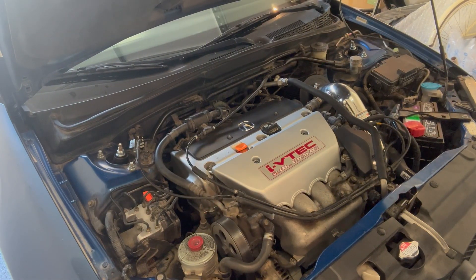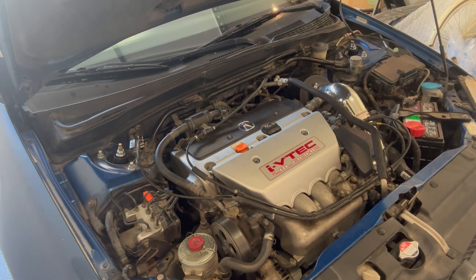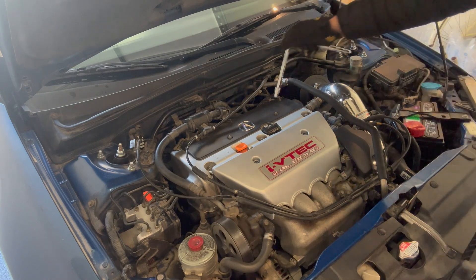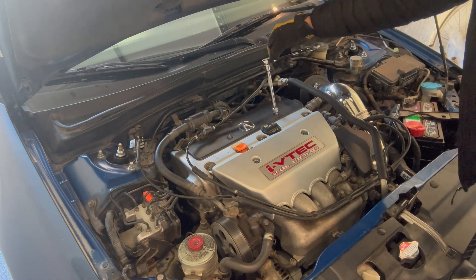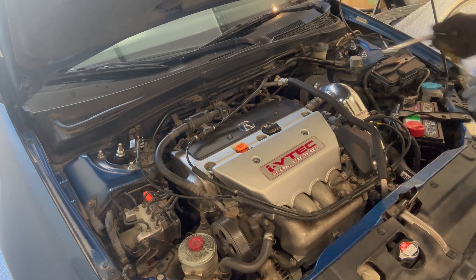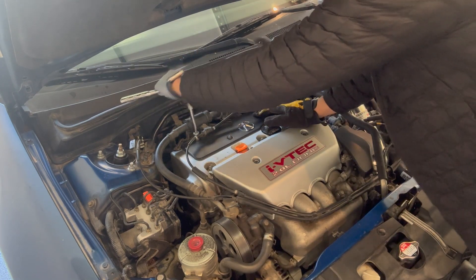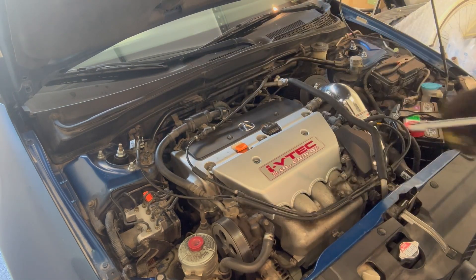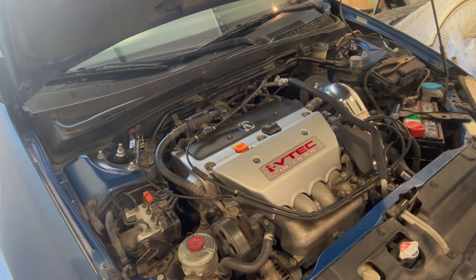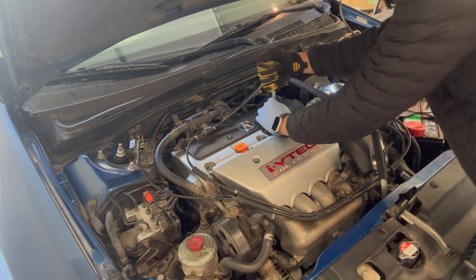The first thing I'm going to do is take out the spark plug cover. It's located right at the top of the valve cover. They're just 10 millimeter nuts and there are about four of them. These are generally torqued back — the manual says 8.7 foot-pounds — but since I don't have a torque wrench that low I'm just going to hand tighten them, which should be fine because it's just a cover, it's not as important.